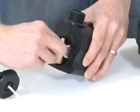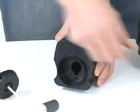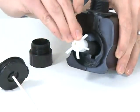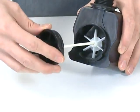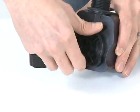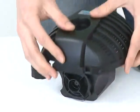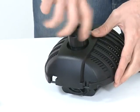Clean the impeller and impeller chamber carefully. If you notice signs of wear and tear, the impeller unit should be replaced. When cleaned, replace the impeller into the impeller chamber, then reconnect the pump housing. Ensure the pump housing locates with the retaining nodes on the pump body.